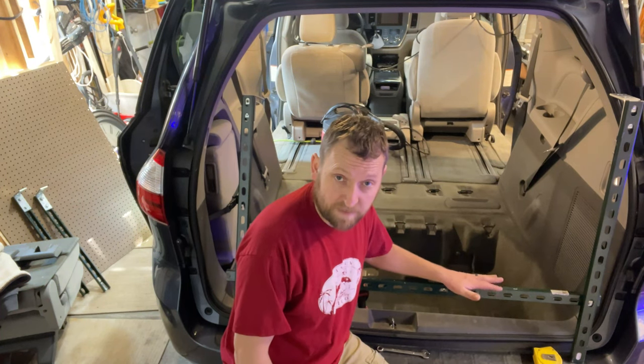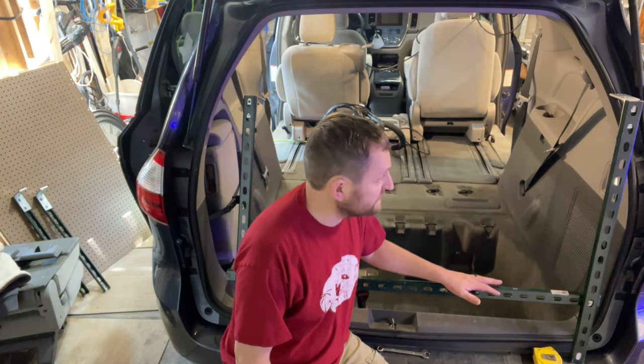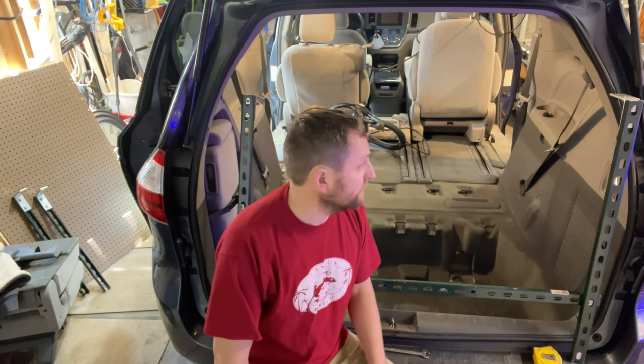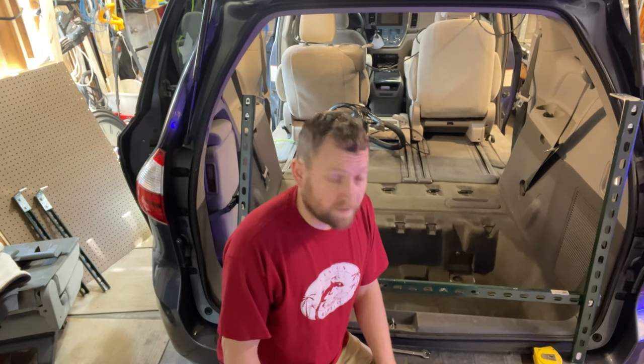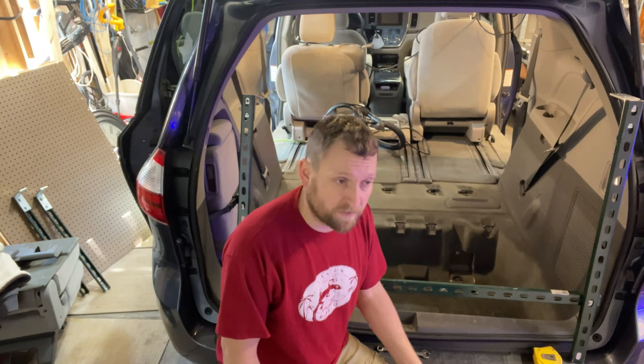I have a cross piece on here because this is where the lid for the pantry sets on. For any hardware I'm using, always use 3/8 — it's super strong, you're never going to break it. I use Unistrut strut nuts, not just bolts. The bolts go into the strut nuts. A lot of people use Unistrut but don't use all the fun hardware that goes with it. It's a little pricier but it works.